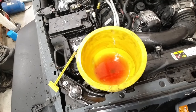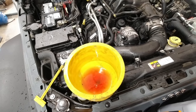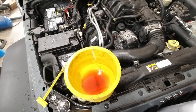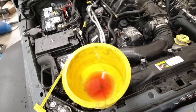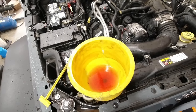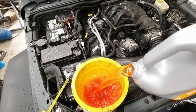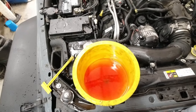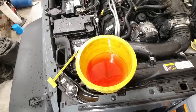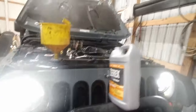Less than a minute and it's starting to bubble — air bubbles are coming out and the coolant level's going down. Sometimes you can just take your heater hose and pump it a little bit, and that'll help get some air out. I'm going to put just a little bit more in it to give gravity a little help. Looks like it's overheating and volcanoing again — not good.